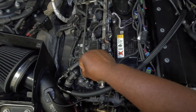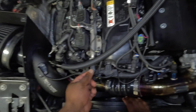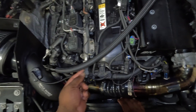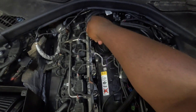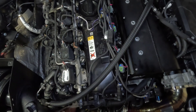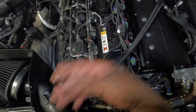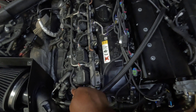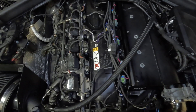Moving down, we've got all six coil packs, one for each cylinder. Underneath the coil packs are spark plugs — remove them using E8 bolts, then a 12-point socket for the plugs themselves. On top there's our fuel pressure sensor, which measures your rail pressure as seen in tuning logs. We also have six injectors along here, and our intake and exhaust cam sensors. These are identical sensors reading off wheels bolted to the cams — you can swap them to diagnose if a fault follows the sensor.